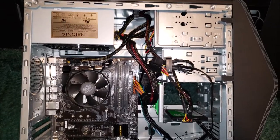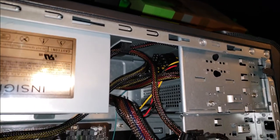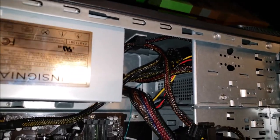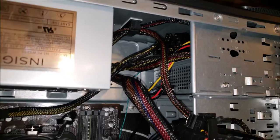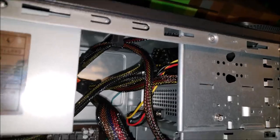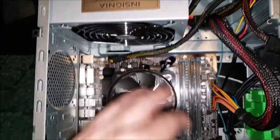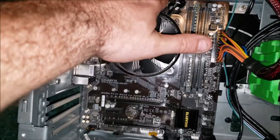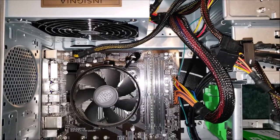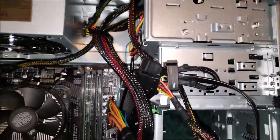At this point we pretty much have the cable management under control. Since the CD-ROM drive wasn't there, it's a good place to rubber-band everything you don't need and tuck it up there. Same with where I branched off for the hot swappable - I was able to tuck it in and clip it to keep cables out of the way. If I was OCD you could make it cleaner, but this isn't an open case and I don't think it'll impede temperatures.